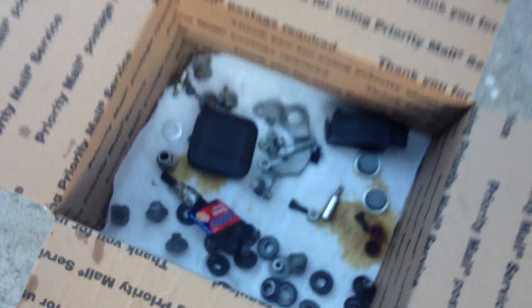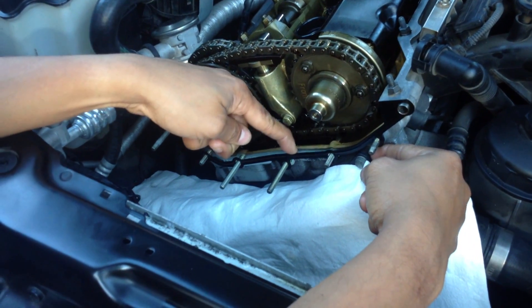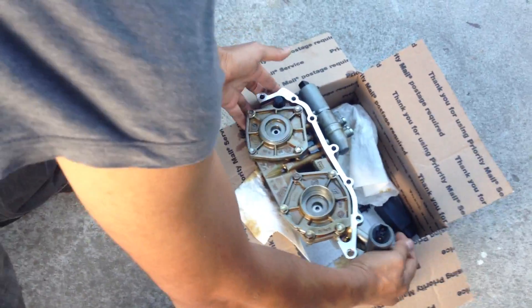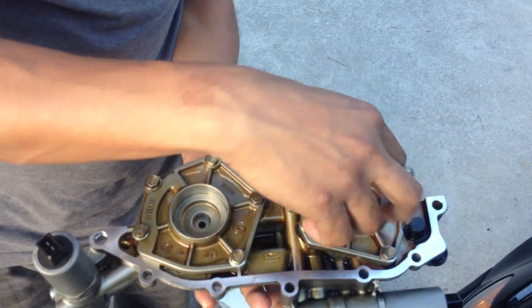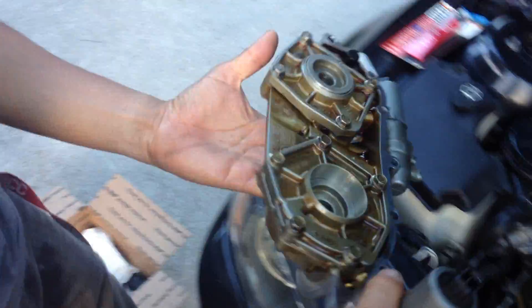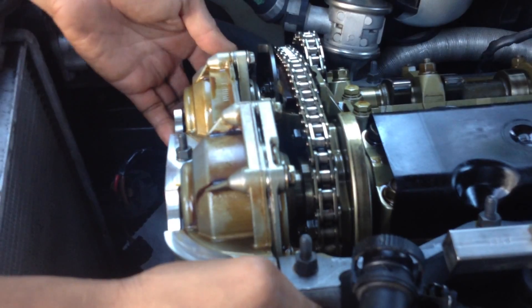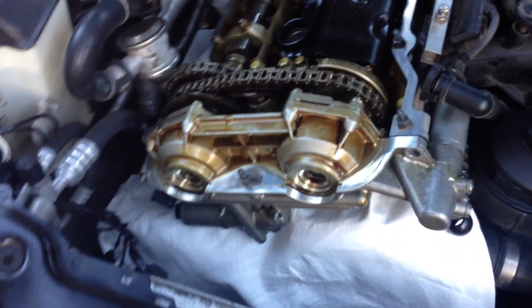We are going to put the cover back today. I have all the parts right here — everything I took out from the car. I just replaced the gasket; this is the new part and this is the old one we're going to save. I have my vanos ready to mount back. This is the vanos piece — I changed the cylinder gasket inside, the old rings are already changed, and now I'm going to mount it back. Make sure you put it in the right place and everything will go exactly as it should.